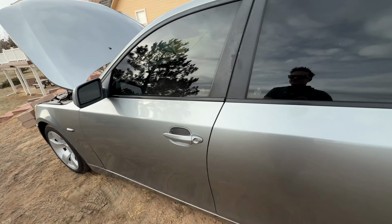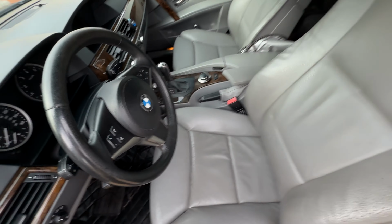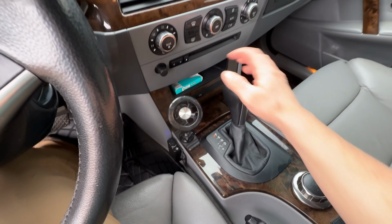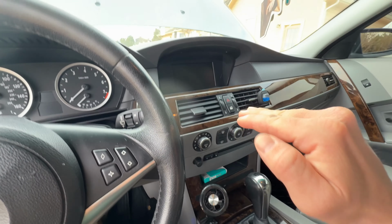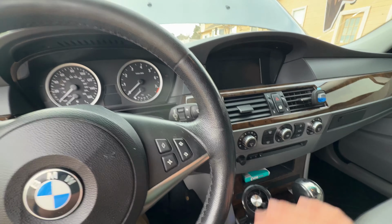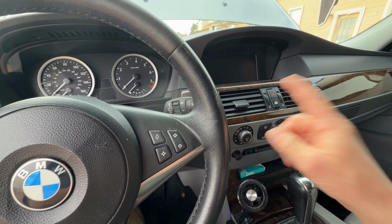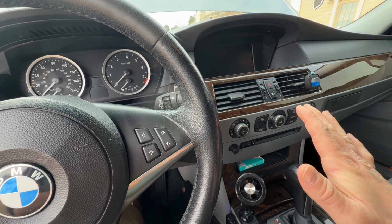So the other day I did some shopping, and when I left and started my car, put it in drive to go away, it starts shaking like this, especially with my foot on the brake. I was like, oh, definitely a misfire. It smooths out a little bit as you start driving, especially with just one cylinder on an inline six, but you could definitely tell it was misfiring.